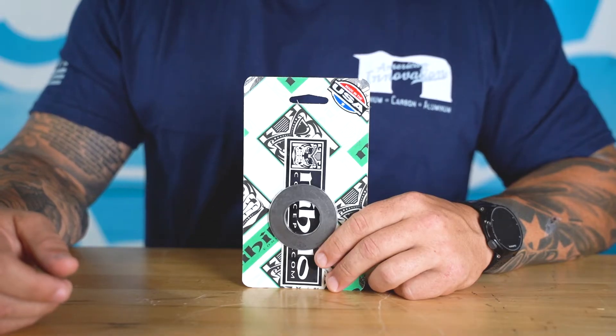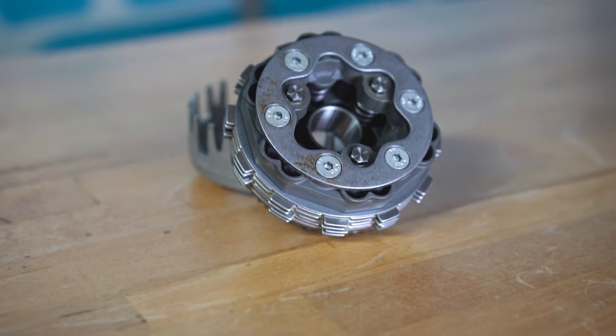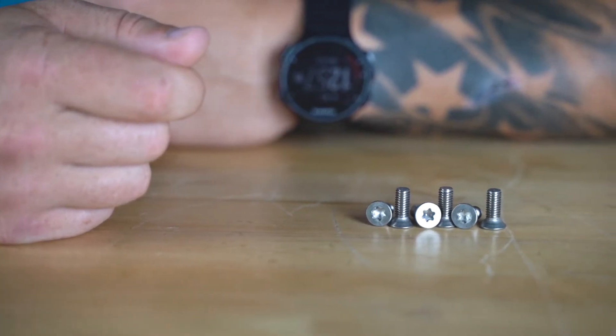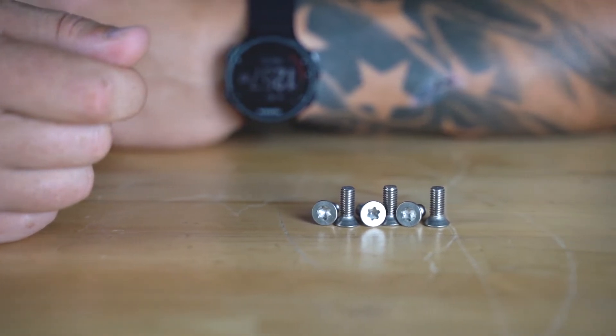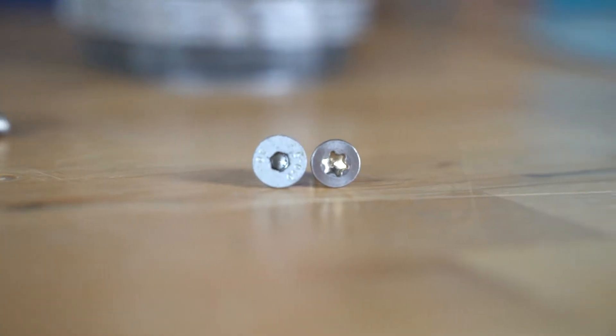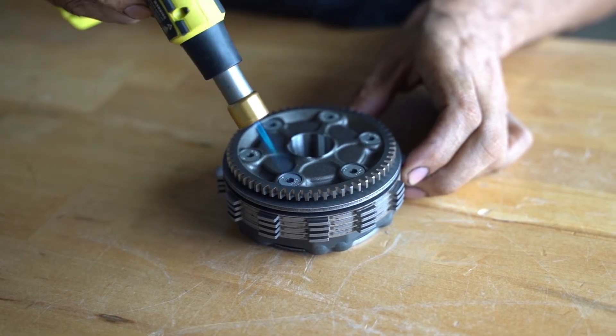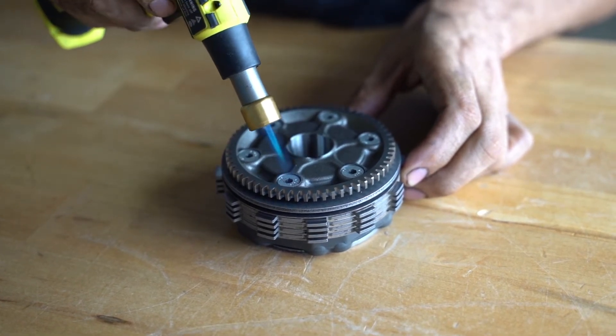In order to change the washer out, you will need to disassemble the clutch — here's where the Torx bolts come in. You will find out pretty quick that the stock Allen bolts will round out and be really hard to get out. Make sure you use heat and a good wrench, but chances are you will be using a bolt extractor on some of them, so you will need new bolts.